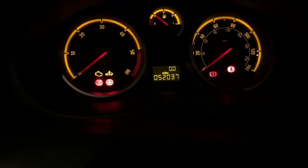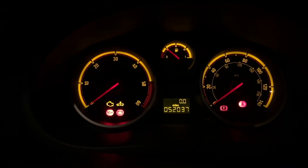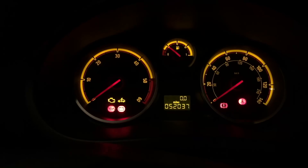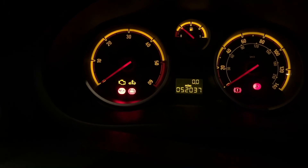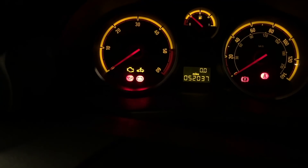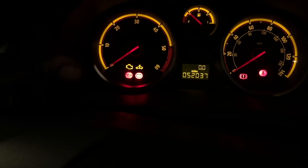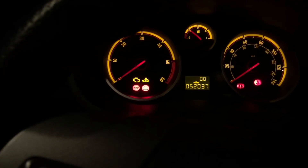Right everybody, I think I'm moving somewhere. It was getting dark and I was putting everything away, then I decided I would go and start the car again. When I put the ignition key on, I noticed - you can't notice it in the daylight but you can in the dark - the dash lights were just a bit dimmer than normal. At the same time, these two airbag lights flashed on, and the hazard light went a little bit dim too. When I cranked the car over it would not start. I left it for 10 minutes and eventually it did start again.